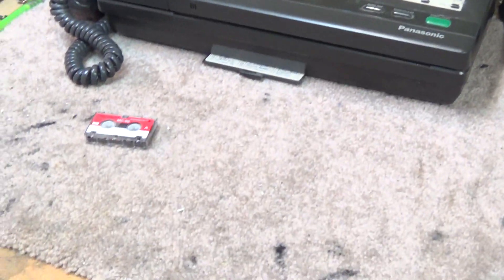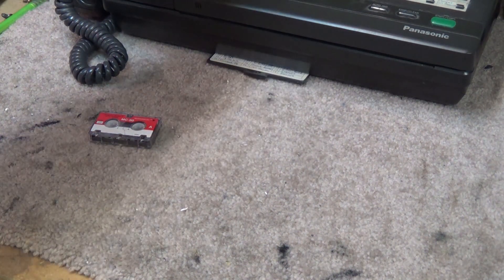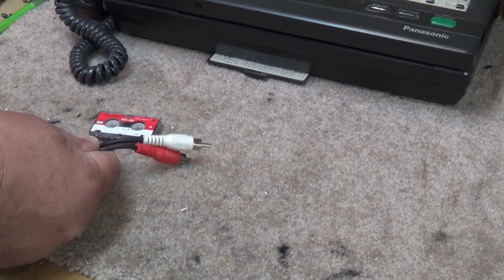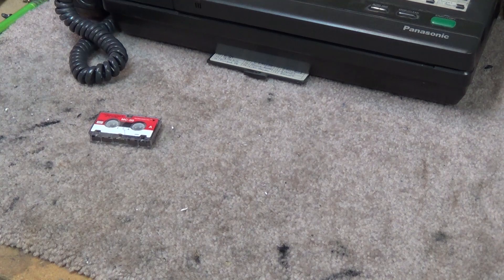That's the purpose of this video. We're going to open up this machine and attach a line-out cable — in this case going to the speaker. We'll use a little bypass capacitor in there to isolate the speaker circuitry from the line in. We'll put an RCA plug on there so that we can plug this into our system and copy it onto a computer. In this case I'm going to copy it onto my PC and then burn a CD for them.